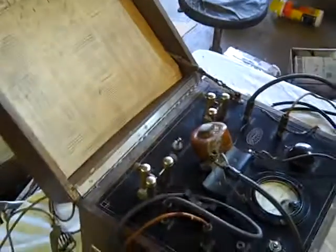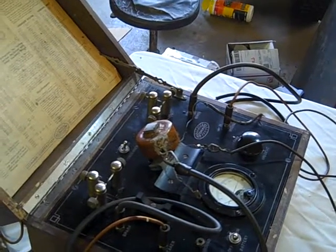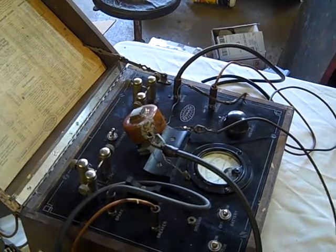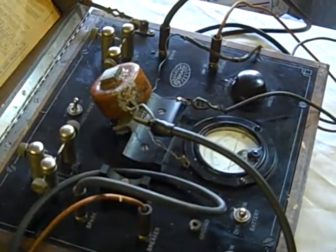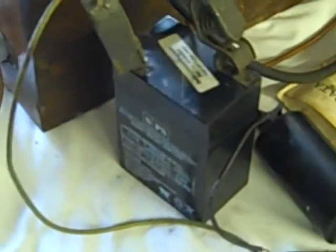What we have here is an Iceman Windings Tester, as it's called. It's really the same as what was called just the Coil Tester by its name. What this does in any kind of tester like this is actually test the coil's secondary winding. I like these units a lot better, even if it's as old as it is. The function of it is duplicating exactly what's happening on most motors, whether they're two-cycle or four-cycle — introducing the voltage, which is DC, by its own battery, as you would with either an automobile or any one of the cycles that are used.